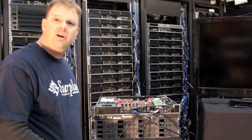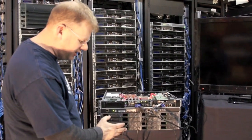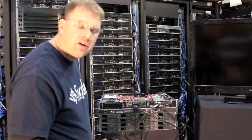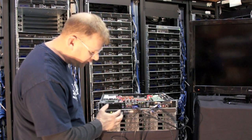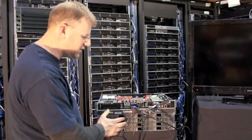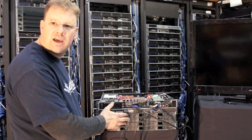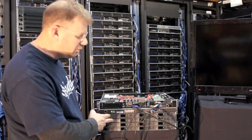With 16 hard drives, you can have tiered RAID, which is RAID 0 and 1. That means that you can actually stripe across many disk arrays, which is RAID 0, and then mirror those pairs. This gives you twice the read performance, and then 4 times the write performance, because you write to 4 hard drives at once. So you get 8 times your read by reading from 8 hard drives at once, and you get 4 times write performance. That's mirrored tiered RAID, which is very important.